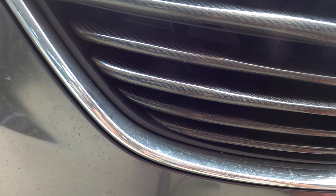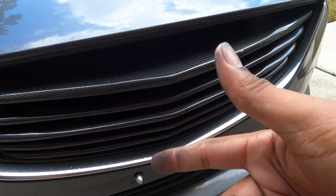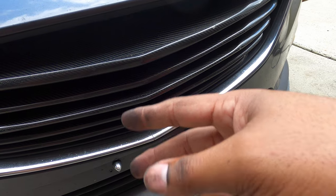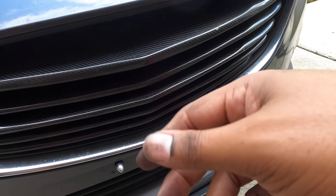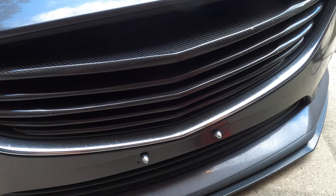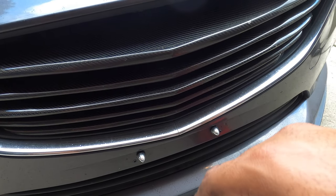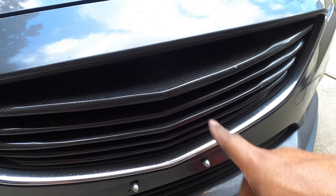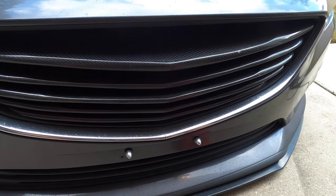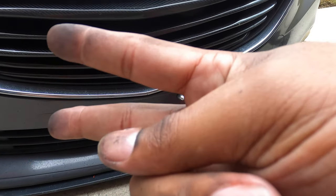If you're doing something like this, or if you have a grill attachment or overlay where it needs to be 3M taped: wipe it off with alcohol — 70 or 99 IPA — 3M adhesion promoter most definitely, and 3M VHB Very High Bond. I'll have links to everything in the description below if I can find the adhesion promoter on Amazon. It works incredibly. Now my car doesn't look snaggle-tooth anymore — it's back to looking as good as a 10-year-old, 260,000-mile car can look. Like everything you do: think, build, enjoy. Peace.